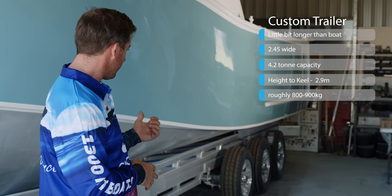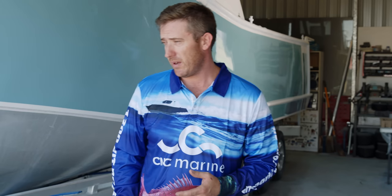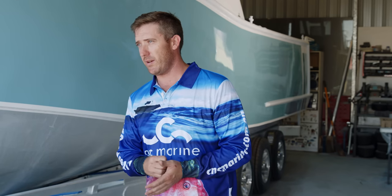4.2 tonne rating for the trailer, so it's got a 70mm hitch on it, which is a bit small for the old Colorado — so Colorado will tow it. The overall weight will be under 3.5 tonne full of fuel and water. I don't know how it'll go until I get it over the scales, but I'll be able to tow it with the Colorado. It's not much bigger than the caravan we had, just a little bit wider.